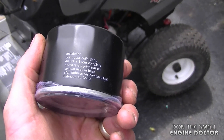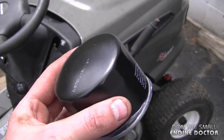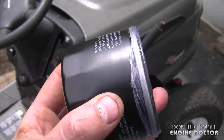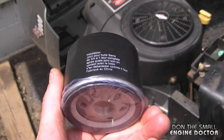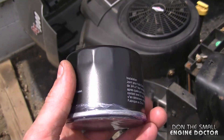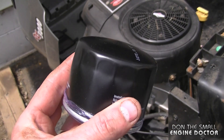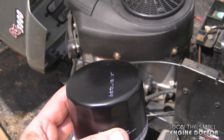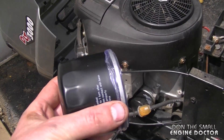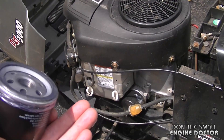The first question I'll be answering today is about oil filters on lawn tractors. Somebody asked whether the engine will last longer if you have an oil filter. My answer is yes and no — it depends on how you maintain your equipment. It is better to have an oil filter, but even with a filter you should be changing the oil regularly. If your tractor doesn't have an oil filter, you may want to change the oil more often.